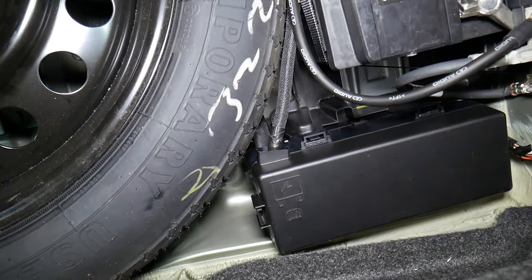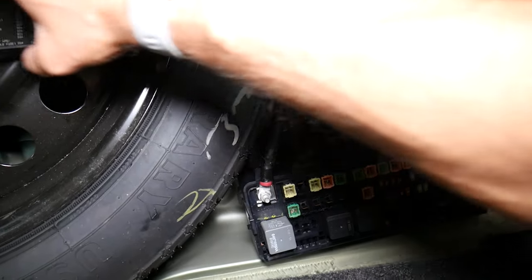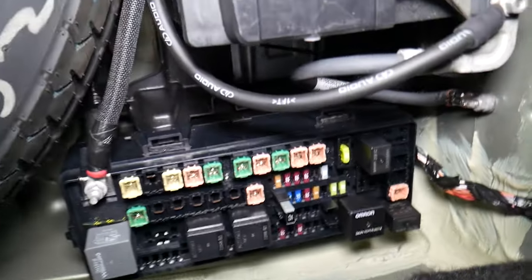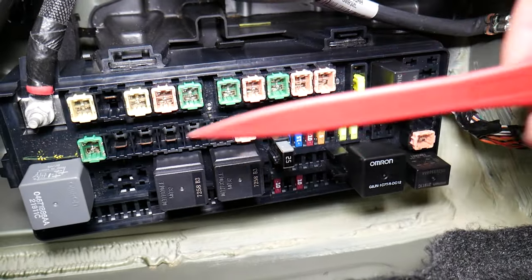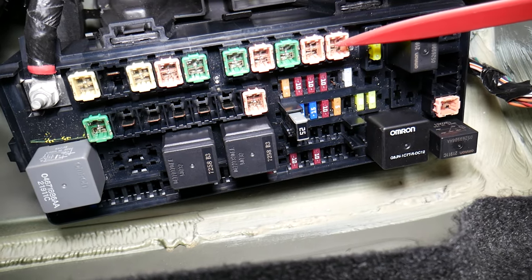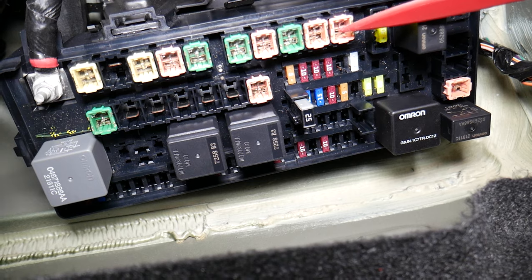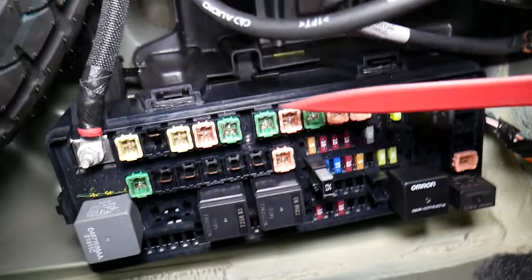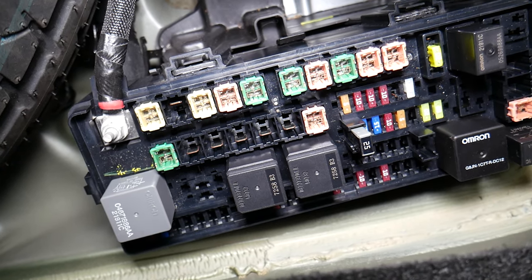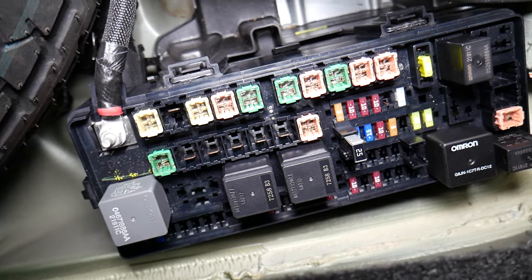This is the fuse box that we will need. We're going to open it by pressing here and flipping that way. These are the fuses and the relays — always test fuses and relays. Fuses sometimes you cannot clearly see if they're burned; they look perfectly fine. You pull it back in and start wasting time and money fixing a problem that doesn't exist. So always, always test fuses.